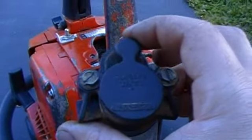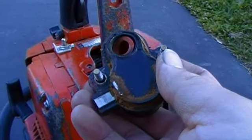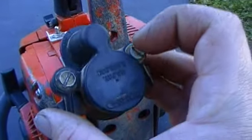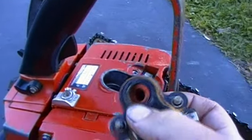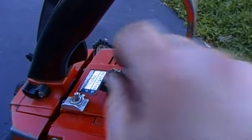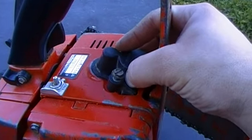I'm pretty sure that one of these is probably pretty hard to come by, so I hope it's good. It's kind of a difficult situation to test in this case too, because you don't have a normal spark plug lead coming out to hook a spark plug on to check for spark. You have to have this coil properly mounted, and you obviously have to have the spark plug screwed into the cylinder as well.